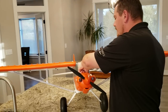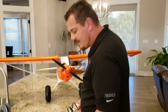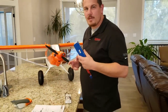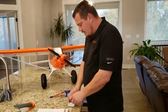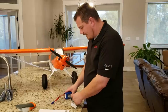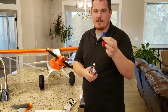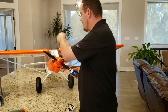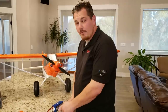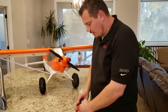All we have to do on this plane is pretty straightforward. We're going to pull out the battery tray, get the battery in there first, and see where the CG sits as part of the initial setup. It is kind of nice to have it set up for a particular battery you expect to use. I'm going to start with this 4000 milliamp 6S Turnigy Heavy Duty 60-120C pack. I've got the modified HXT 4mm ends and then I built in an adapter that takes me down to EC5 which goes into the IC5 connector in the airplane.